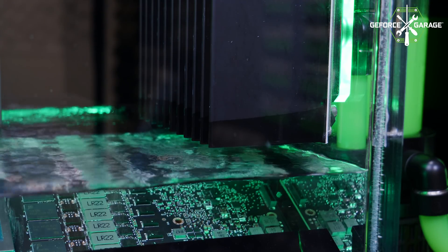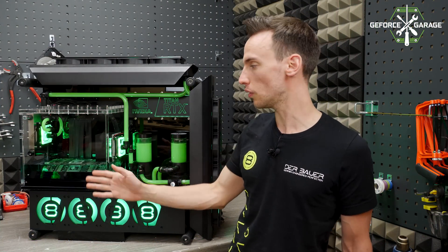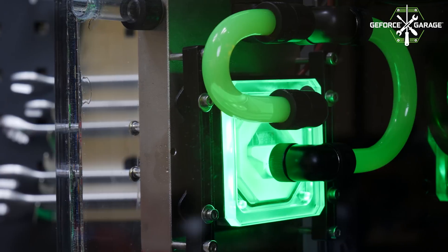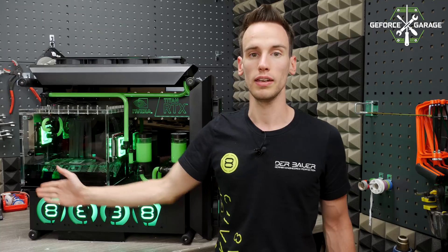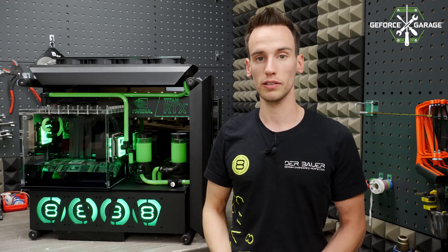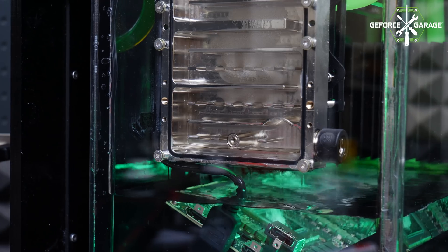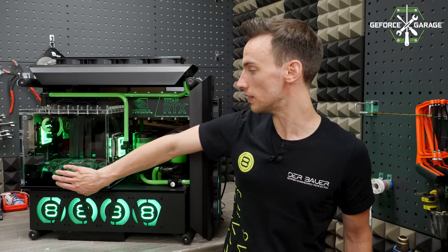As mentioned before, it's temperature controlled, so this will always stay at about 18 degrees Celsius. On the left side we have another cooling element, which is again cooled by an EK block, and in between we have a Peltier TEC element. This side is not temperature controlled — it's always active to make sure we always have active condensation, because the Novec 7000 is constantly evaporating and boiling and we have to make sure there is no loss of fluid.